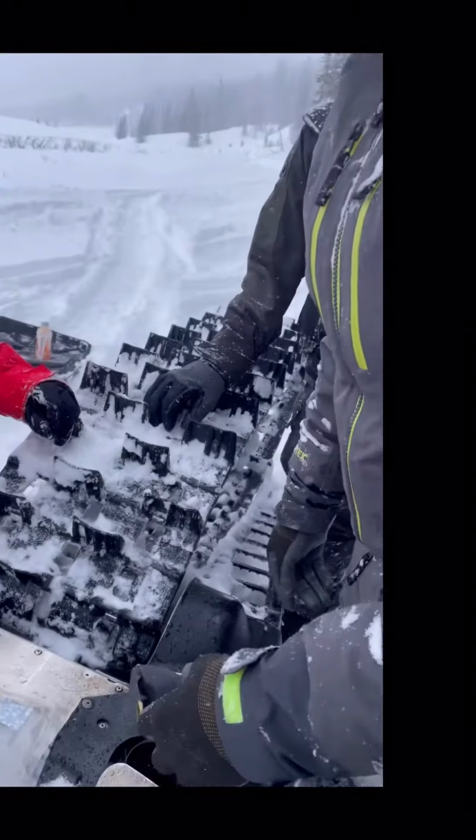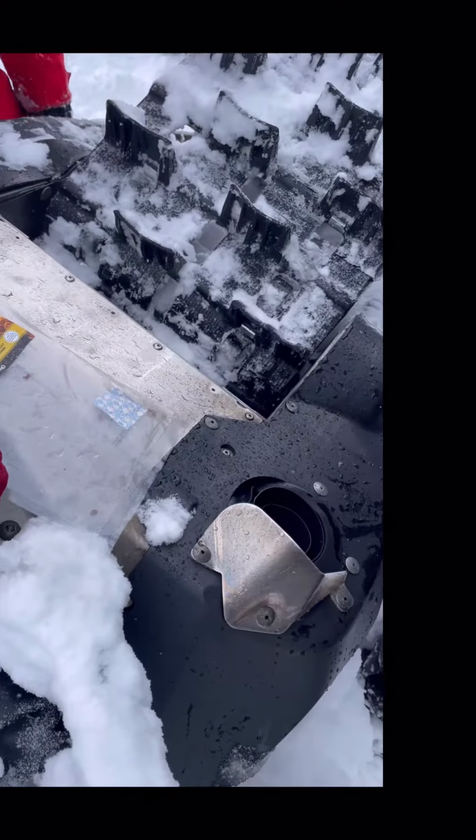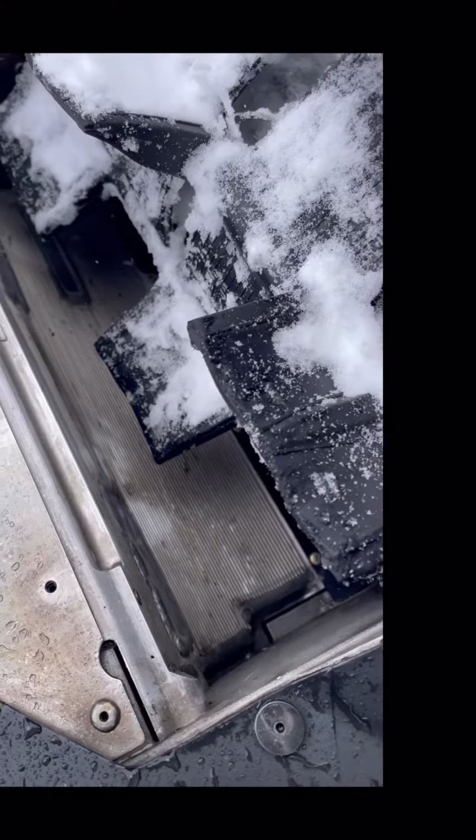Today on Redneck Rescue, we've got a Skidoo thing that is now a Polaris thing, where we've got a hole in the heat exchanger. The hole. It's all the way back in here. Oh, nice. Caused by a stick. Put a crack in the weld. So we got some 5-minute epoxy JB Weld that we're going to use.